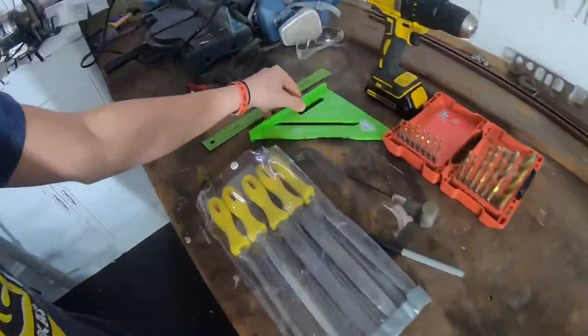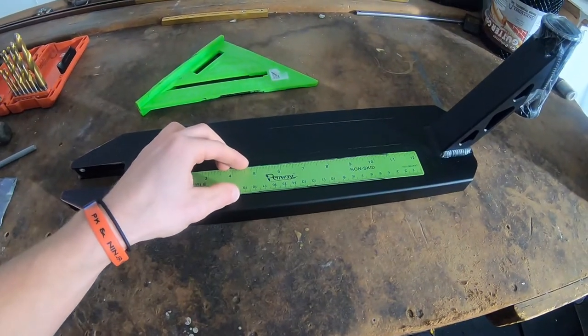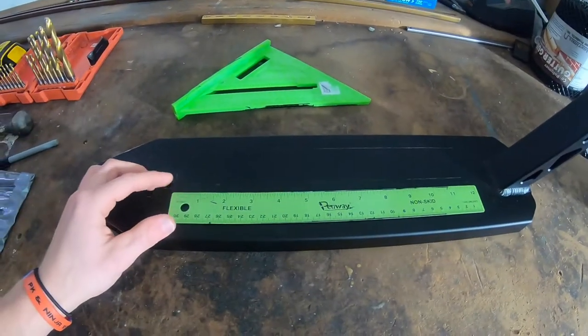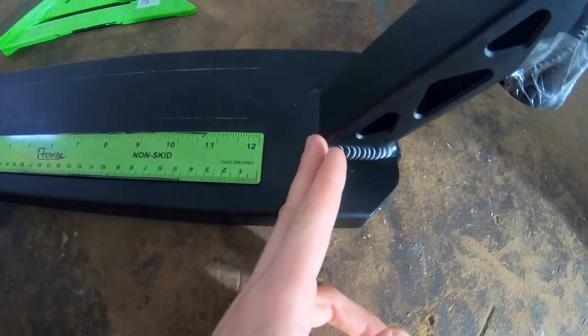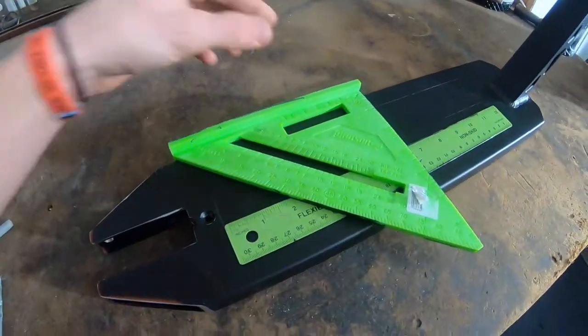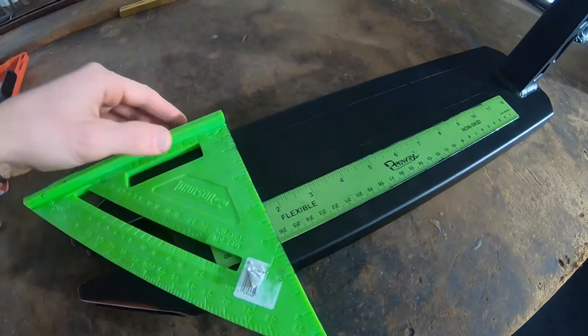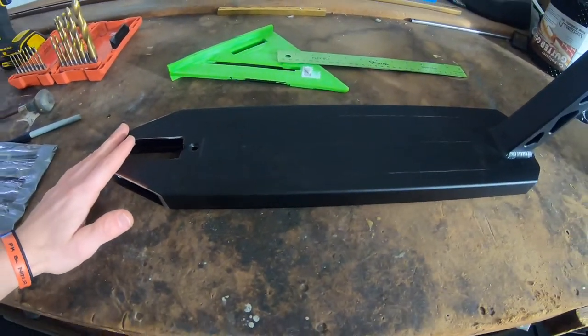Now that you have all the tools, grab your scooter deck, your right angle, and your ruler. Place the ruler on the scooter deck where you want it — I like to tape it down so it doesn't move. I'm going to start my marks at an inch and a half away from the back brake and go no further than an inch and a half from the welds. I use my right angle on the side of the deck to start making marks where I want the holes. I've already found the centerline and the two outside center lines and marked them off.